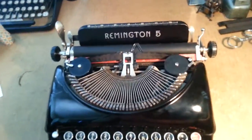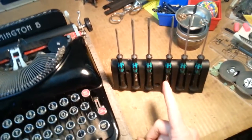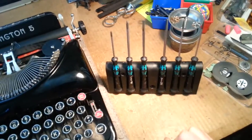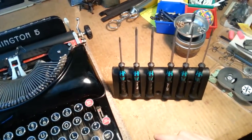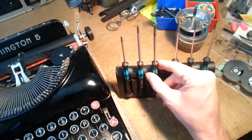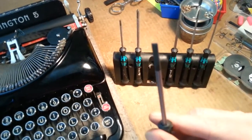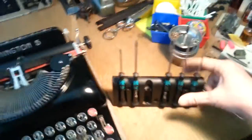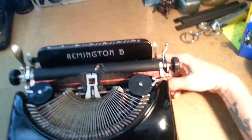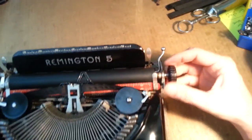Pretty easy to do. All you're gonna need is a screwdriver — you're gonna need the right screwdriver, though. This is a set that I bought at Woodcraft. It has varying thicknesses of slotted screwdrivers. This is like 25 bucks, and you can get better, but you can also get a whole lot worse easier than you can get better. You're not gonna find anything at Lowe's or Home Depot that's gonna work, just because they made screws differently back then, and that means they make screwdrivers differently now.